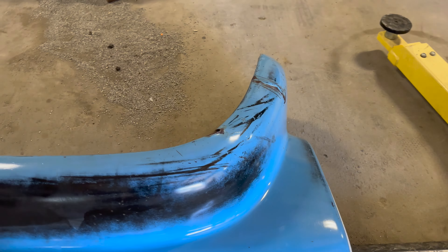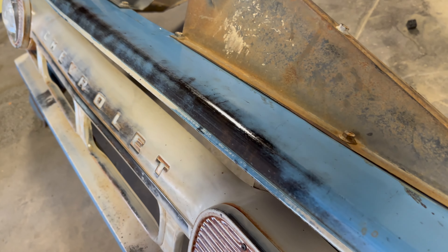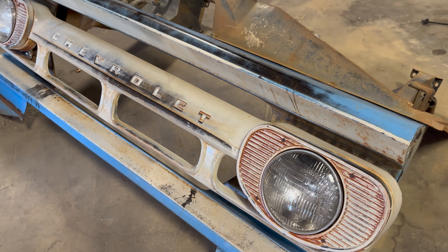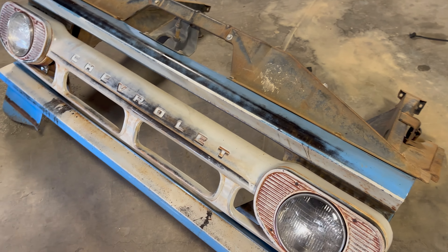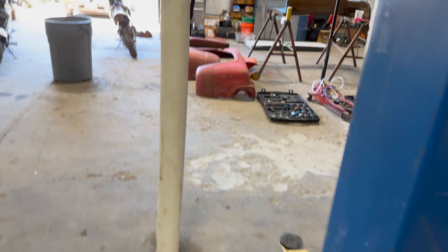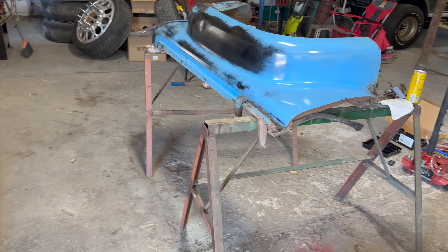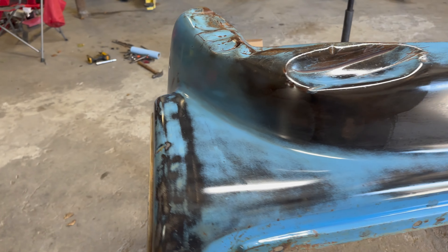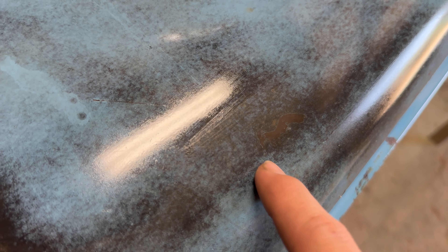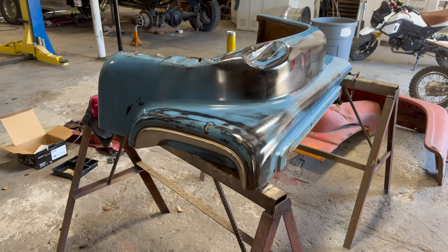This looks pretty good on camera — I'm sure it looks a lot better — but I'm really looking for that deep, rich depth out of this clear. I think the heat just allows it to evaporate too fast; you can't work with it as easily. That's why I didn't do anything on this cab — I wanted to make sure it's laying on there really solid, a nice good first coat. It's left me a little disappointed, so I'm waiting for a callback from the owner of Poppy's Patina to talk with him. I've applied this stuff a handful of times and it goes on perfect every single time, but it should give me a real thick clear and it's pretty thin because I think it's evaporating too fast in this heat.